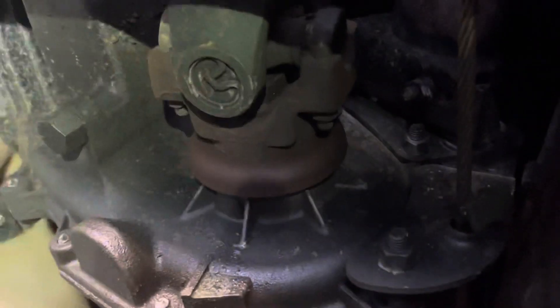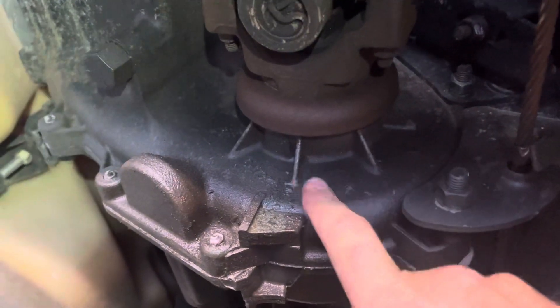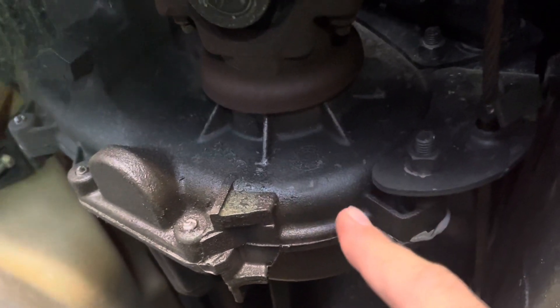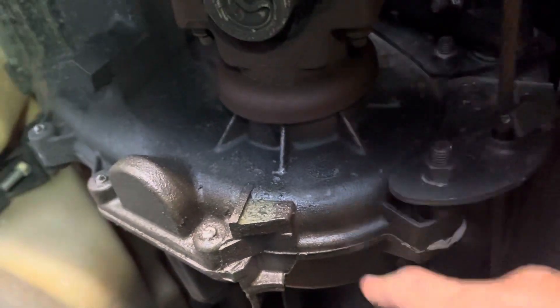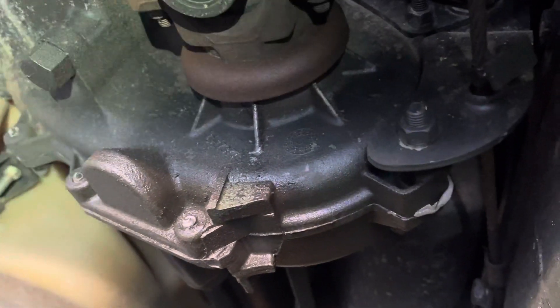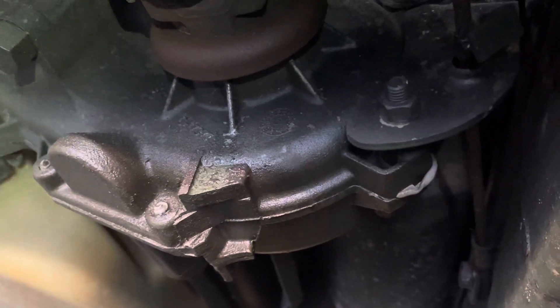What happens is that cooling loop — it's supposed to be passive inside the transfer case — but the internal components will sometimes break open, and all it ends up doing is pumping transmission fluid into your transfer case, which can cause the seals to leak and you can grenade your transmission, which is oh so fun. And then eventually grenade your transfer case too.